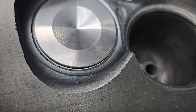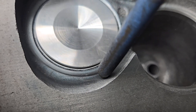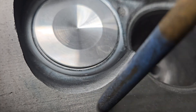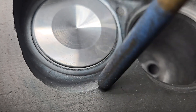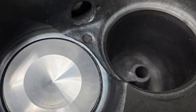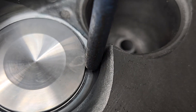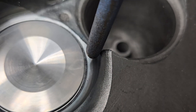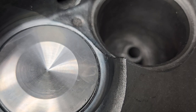It was funny because the way this was originally done it was very, very tight and it had a sharp edge here, so I wanted to round it just a little bit, give it a little bit easier entrance into the port. Then when I did it, this side was still really tight to the valve, so I said you know what, I'm just going to do a light plunge cut and then radius this and have a little bit easier transition into that port where the valve is.